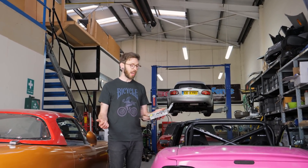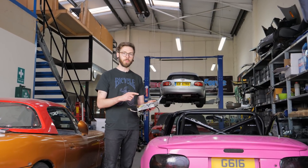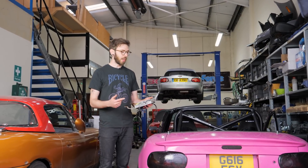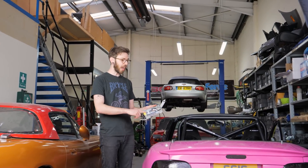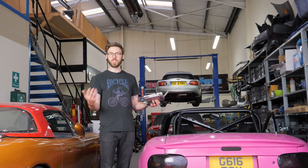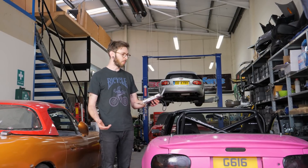I'm going to be able to use CAN out, so that means I can run my CAN check from the ECU. At the minute I've got an adapter box for the Me221, and I'll be able to put sensors into the Me442 and then send them to the CAN check so I can see it all on my CAN check to monitor what's going on, which I'm super excited about.